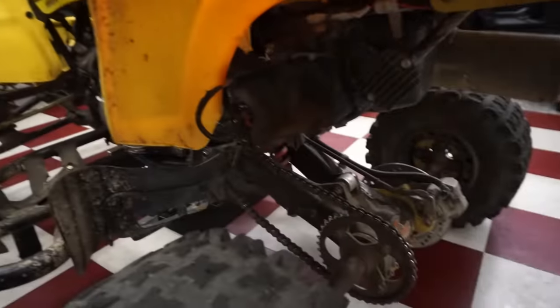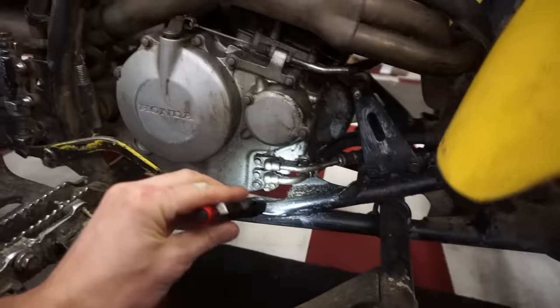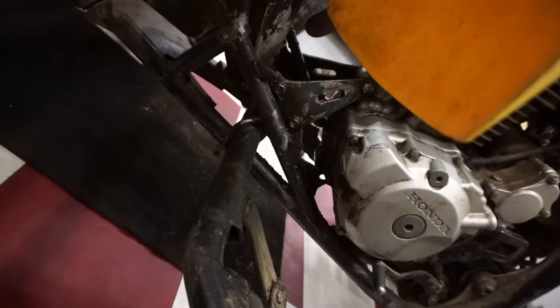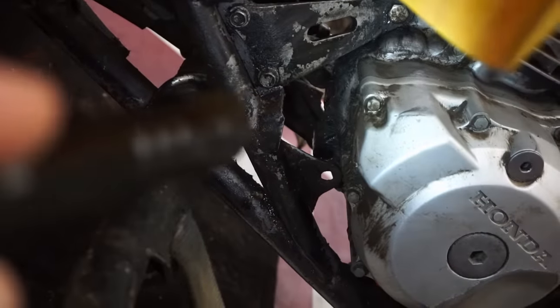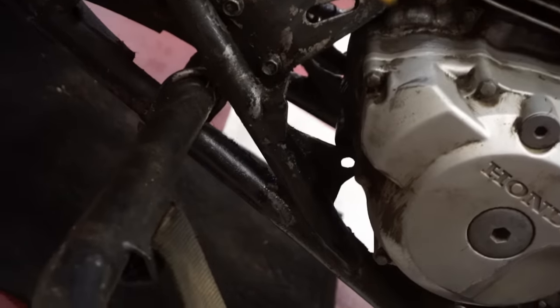It is missing the battery - not really a problem. The clamp here is missing, so there's a big exhaust leak. One of the mounts is broken down here on the frame - there should be a bolt going through the engine down to the other side of the frame, but the mount on the other side is broken off. So that's just awesome.